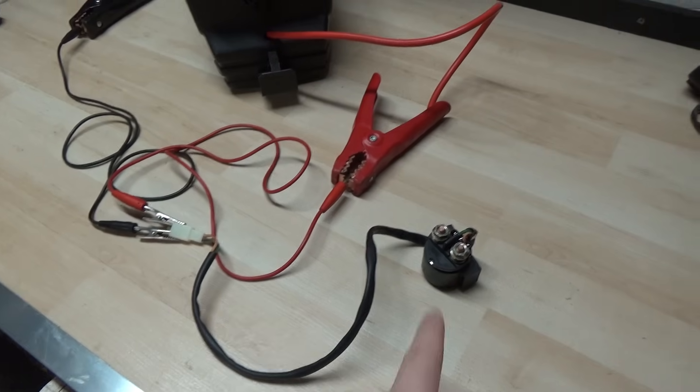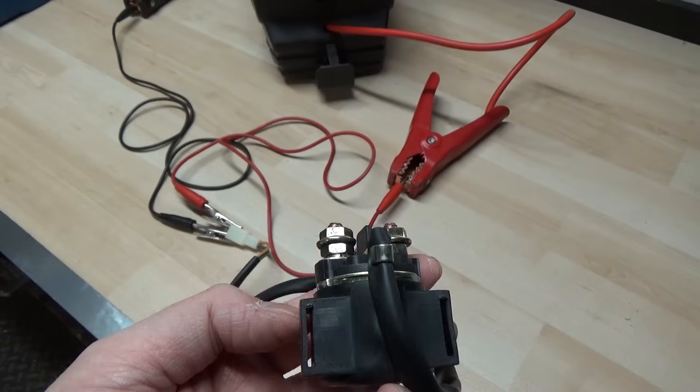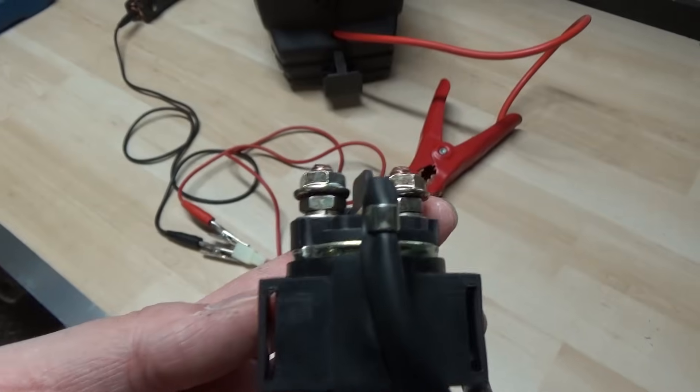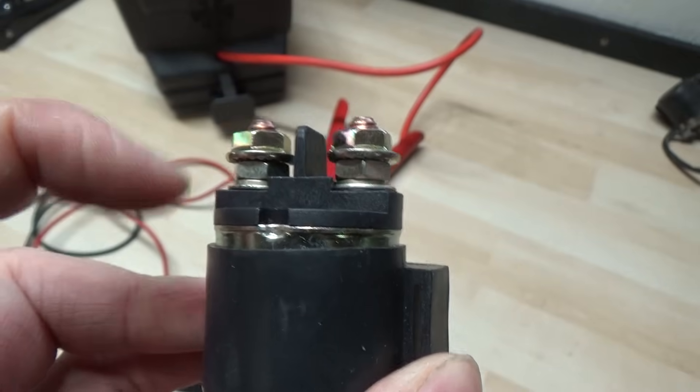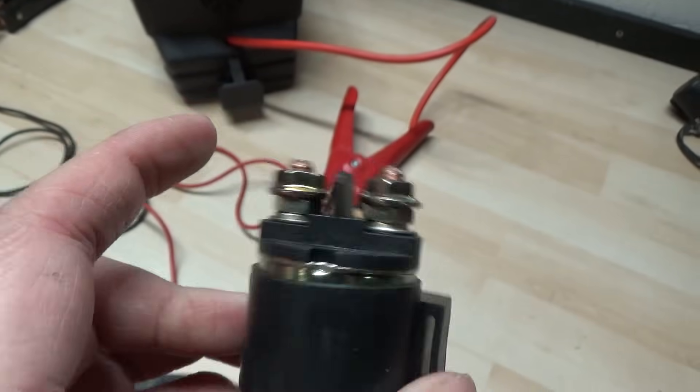We can do a continuity test between the two terminals at the top. What we tested was the magnetic pickup — essentially we're testing that the wires are good and that 12 volts is going through that connector. It could just be the connector at the ends of those wires, or it could be corrosion caused by water or the thing just sitting unused. I've seen solenoids before where the magnetic pickup works and it clicks, but there is no connection between the terminals. That is normally due to corrosion right at the base of those two terminals — the plate comes up, but the plate is too corroded to pass an electrical current between the two posts.